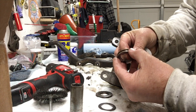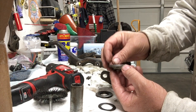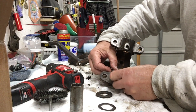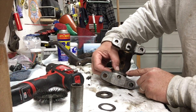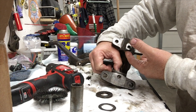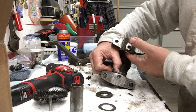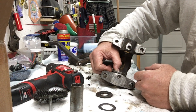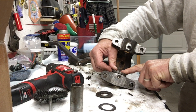So you stack them together like that: brass, shim, brass down, in the cup, cup down, and it goes right there like that. And then you just shim the top to take up the rest of the gap. I'm told it doesn't have to be snug, because you want it loose so it turns — all the weight can be riding on this stuff here.